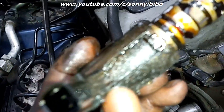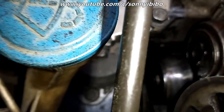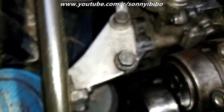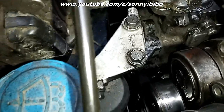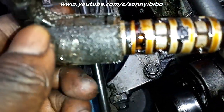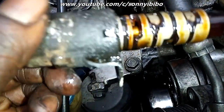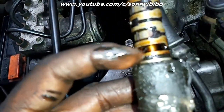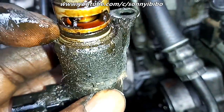This is what has been leaking oil. You can see the underside of it — plenty of oil leak. The oil leak has spread around this part of the engine, even onto the alternator. At some point the oil was dripping and getting onto the serpentine belt, and the serpentine belt helped to distribute the leaking oil around this passenger side of the engine. This solenoid is one of the root causes.